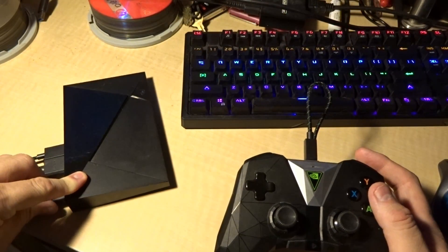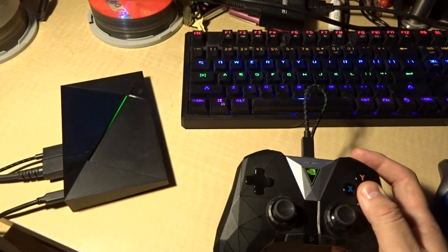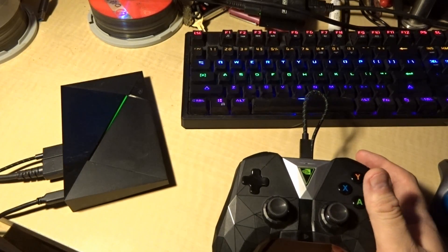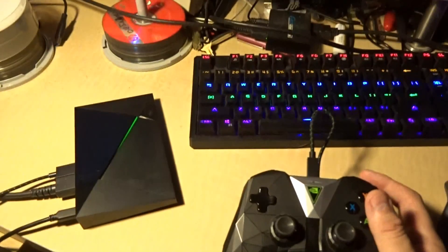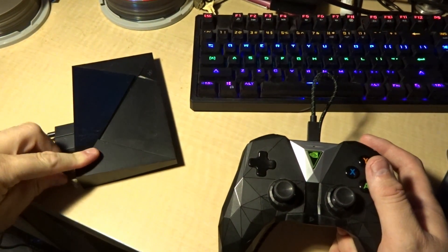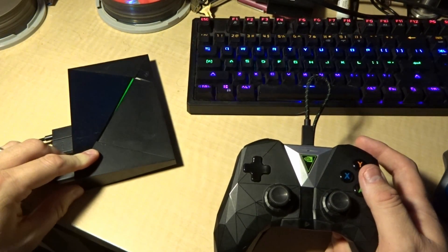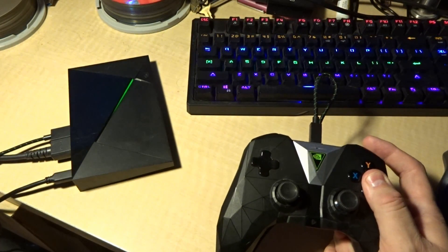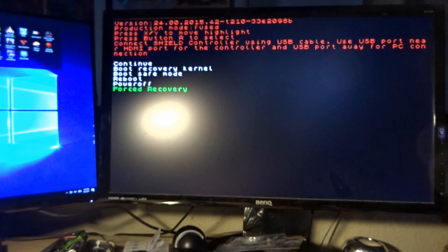Okay, we're going to plug it in. Rumble — hold. And then as soon as we get fastboot up, we're good. Alright, so let's go one more time. It's a little bit of a trick here. Plug it in, wait for the rumble, hold. Continue holding until you see fastboot, and then let go. You've got to let go quickly or it'll try to reboot.